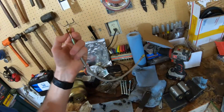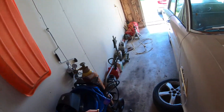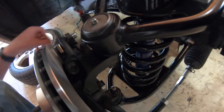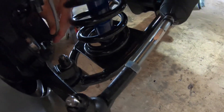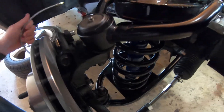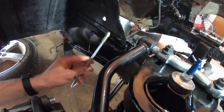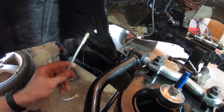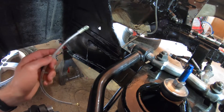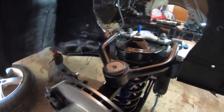So I have these stainless steel braided flex lines. They come out of the bottom here. You gotta get a bolt on here and then they go in there like that. And then I think I'm gonna run them up somewhere in here and mount them right around there. And then we can run the brake line through here, which I think is the original place where the brake line came through, and then we can plug it right into that. So the other side should be about the same.